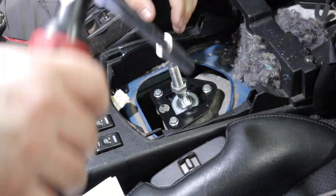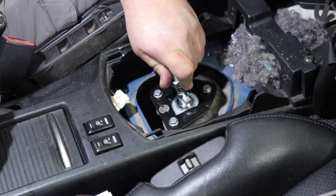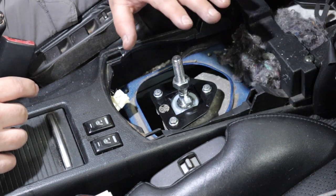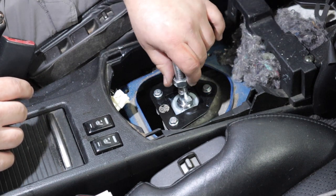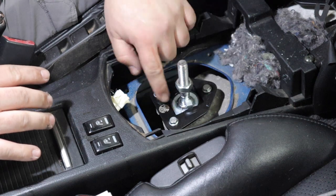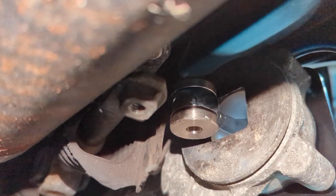You're not going to want to fully torque the bolts yet because there is a little bit of adjustment with this plate due to the reverse lockout. What I recommend is leaving the shifter bezel out and taking the car for a drive — or at least moving it forward and back in your driveway — and making sure the reverse lockout feels good after you connect it to the transmission down below. There is some side-to-side adjustment here and you will have to fine-tune it.